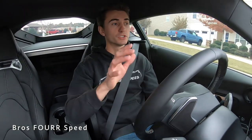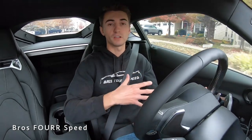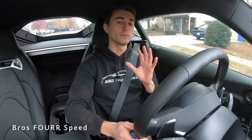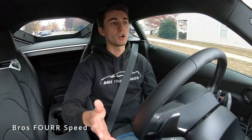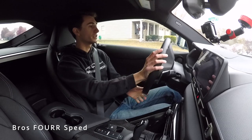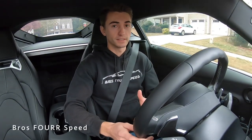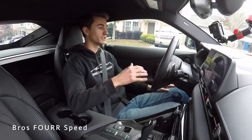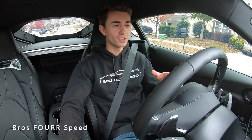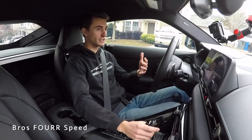Number three: should you put your car in neutral when coming to a stop? A lot of people think it saves gas or reduces transmission stress, but honestly it doesn't really matter. The torque converter's pump has pressure when accelerating to lock both sides together, but at a standstill there's no real pressure — both sides spin freely. In many cars, pushing into neutral at a standstill raises the RPMs slightly; in this Supra, it doesn't change at all.